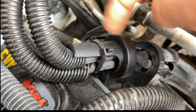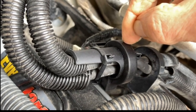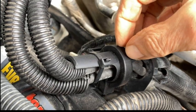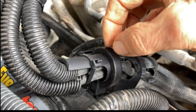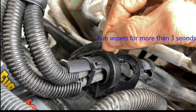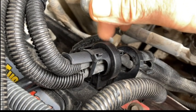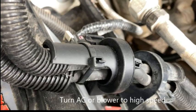You better watch it — if something goes wrong, make sure the headlight bulb isn't burned out, because a bad bulb will throw things into all sorts of weird modes. The wipers will also help: if the wipers are on for more than three seconds, it'll kick the alternator back into charging mode and get you out of the low-excitation state.